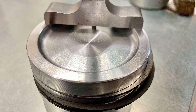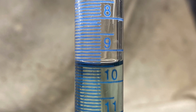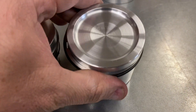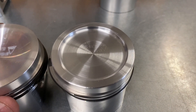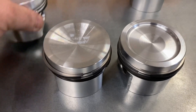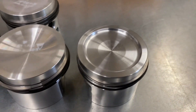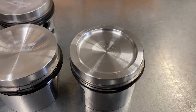With the piston machined and back off, it's on the bench to check the depth which is correct, and then the final check is to verify the new machined volume which is 9.5cc. The piston I've just machined on the right is now ready — the machine is set with the right size dish — and now I need to run through and machine the other three to match. This is a pretty straightforward operation now because the machine is set up on stops, so it's basically a simple rinse, wash, repeat exercise.